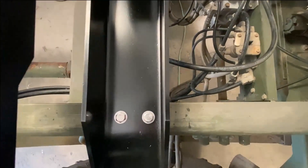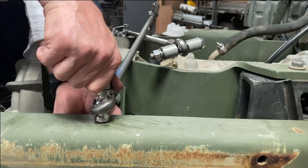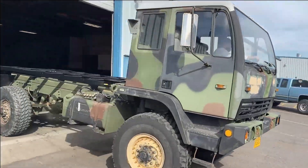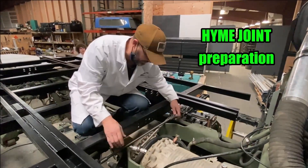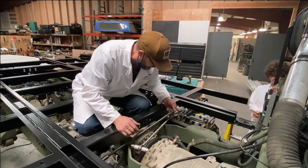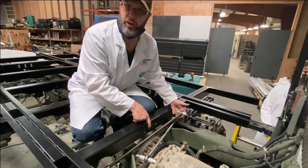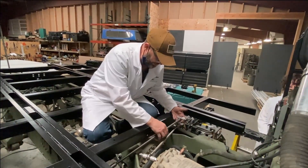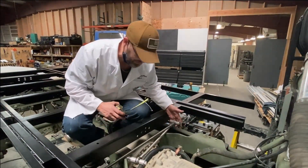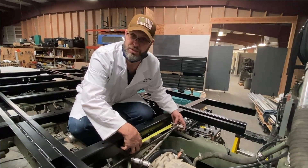Welcome to Part 4 of the Globe Trekker zero torsion subframe build. In Part 3 we discussed the crossmember pivot attaching options, bolted the heim joints to the truck frame, and attached the brackets to the subframe. In Part 4 we will complete the build. We're going to have to cut our all-thread to the right size because it accommodates many different frame widths. I measured the distance from the mounting point to the hole, and that will be the distance I shorten this shaft. Once bolted together you can micro-adjust the shaft position since you can mount it on the inside or outside wherever needed in the frame.